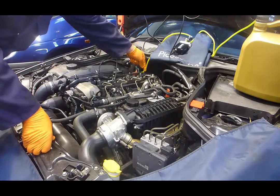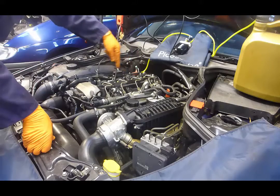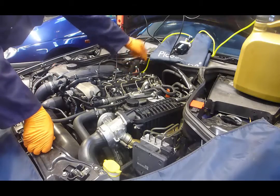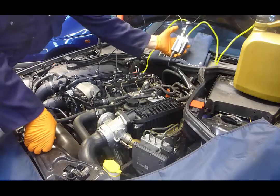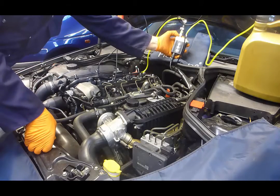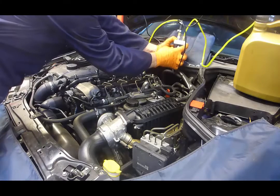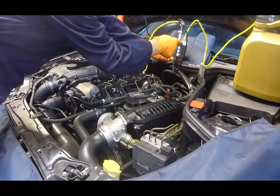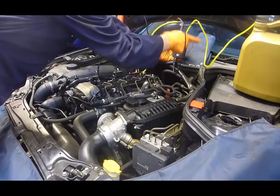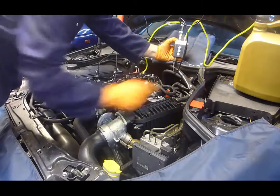Connection-wise, we are connected to number four injector on this vehicle, so it's at the end of the injector rail. Connected into our pressure port we have the pressure tap, bleed tap open, so diesel back leakage can pass through the WPS, through the measurement chamber, and straight out through the spill into the collection bottle.